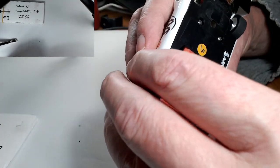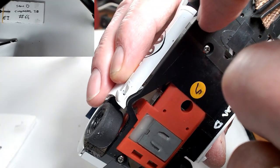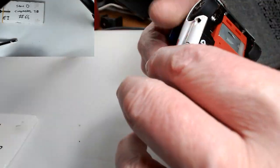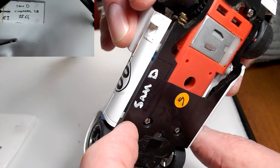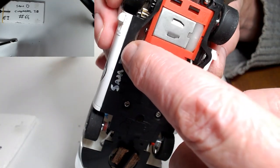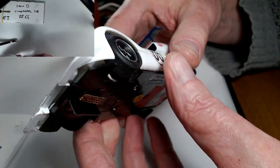I'd expect it, with it being a slotted, that the sills would have those plastic supports. Yeah, there's one there just in front of my finger. There's one here as well. See, there's two there, one by my finger, one at the other end here. That's for the chassis, body to chassis float to be zero basically.